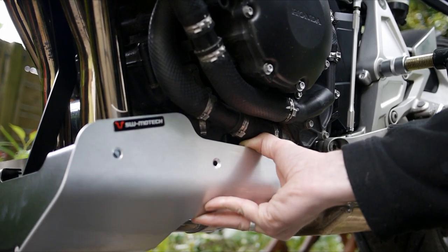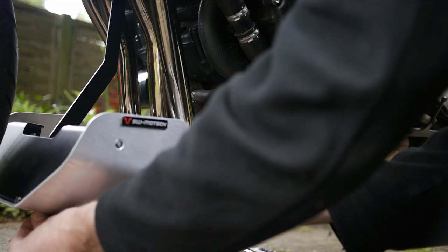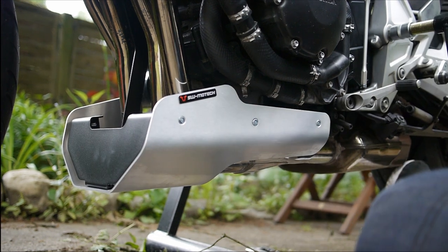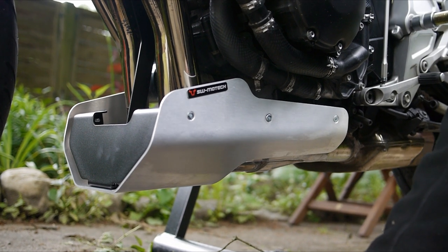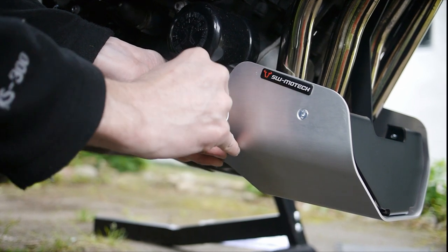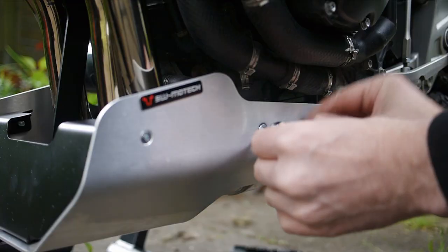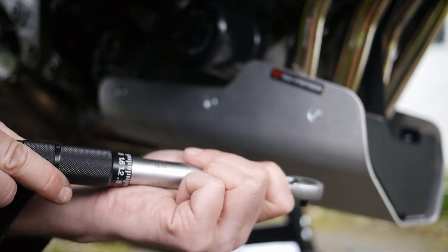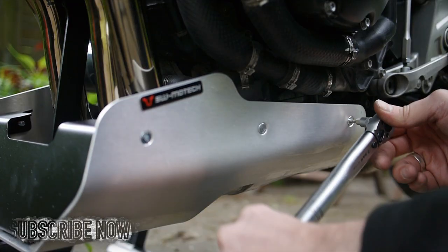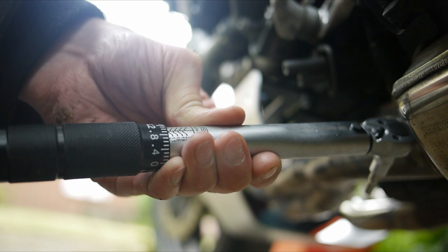So that's how it's going to be - liking the look of that already. Five little bolts need five little dollops of threadlock. So we've got one bolt down at the bottom, two over here on the left, and now it's starting to rain - brilliant, time for the rush job. A little bit of pressure needed to get that last one in line, hence the need not to tighten up all the nuts before everything is seated. That needs precisely five newton meters of torque with my miniature torque wrench, and the brackets themselves need ten newton meters of torque.